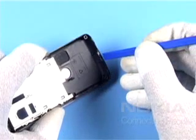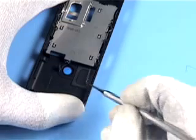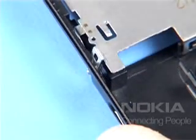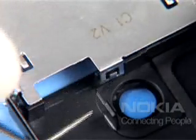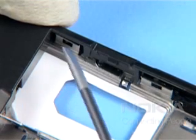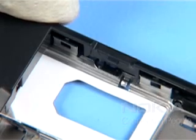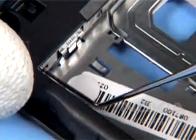The power and the volume key can be removed easily. Release the shown metal snaps of the label cover SE with the dental pick. Turn the assembly and open the SIM lid. Now release these two latches. Use the dental tool to push out the last clips.